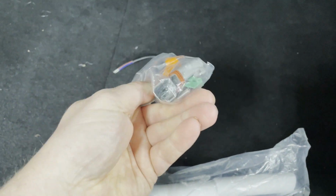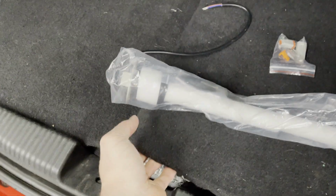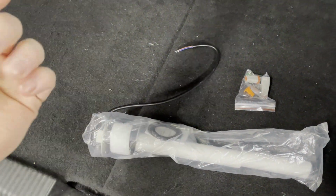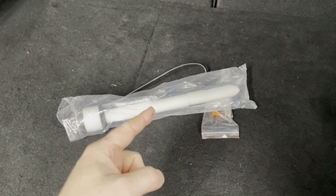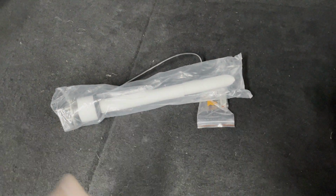So I'm going to change that anyway, and then if there's any bigger problems, I'll fault find. I'll see if I can find what the problem is. Either way, I can't live with that fuel gauge not being correct, because I have run out of fuel already in it. So hopefully this should be a nice easy change. It's two parts. It's one new float of right length, a 2-pin connector. Take this up, get the covers off, pull the old one out, cut it off, make a new hole for this one, and wire it up. Oh, and then go into the computer to fix the resistance levels and work that out.